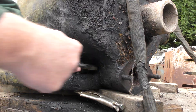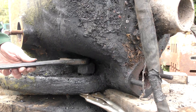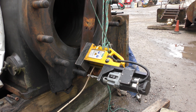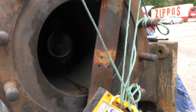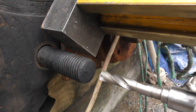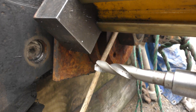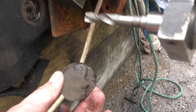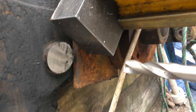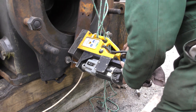We'll have to drop it down now because there's very little room between the nut and the actual casting. The master plan is — as you can see — we've got a magnetic drill. This is the broken stud we've just extracted from the cylinder head. I made this drilling jig; it's a nice snug fit in the hole, and now we decide how we're going to fasten it down. So I'm going for it, as you can see.